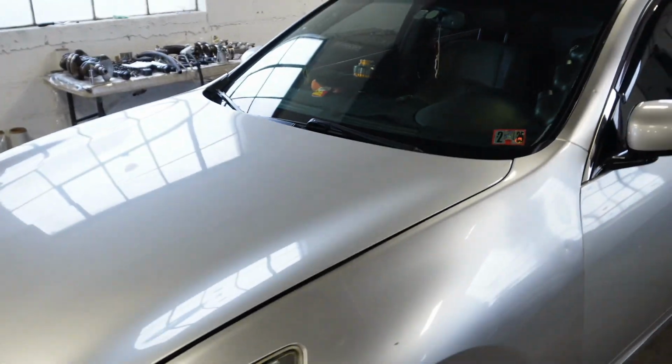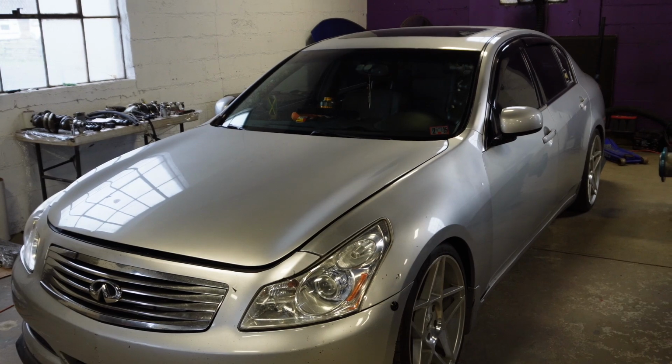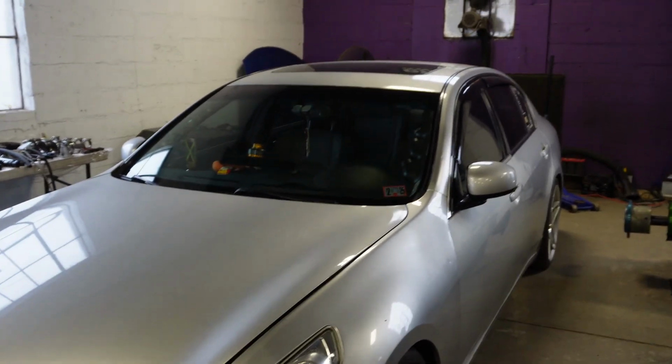We've got Lou's car, that's back. Probably get it bolted up to the hubs today. Possibly make a few loaded runs, tweak some fuel in there and start playing with some timing, but that's literally what's left on this tune. And then I have to explore the torque management options because this is an automatic trans.